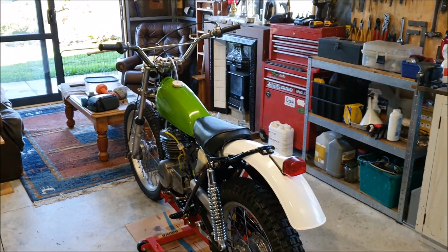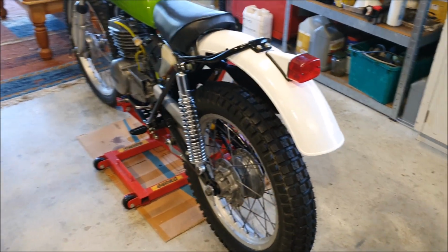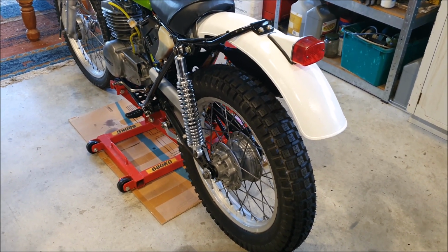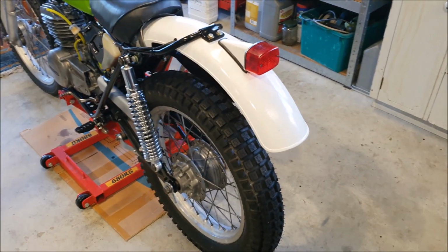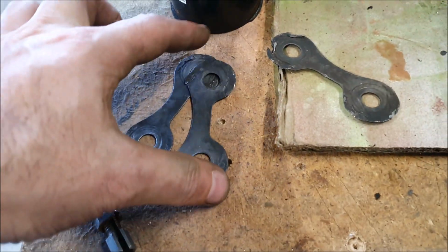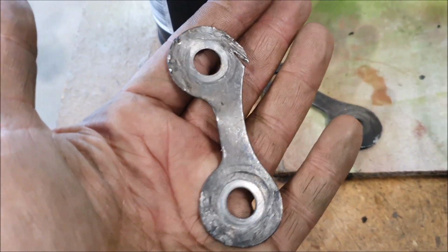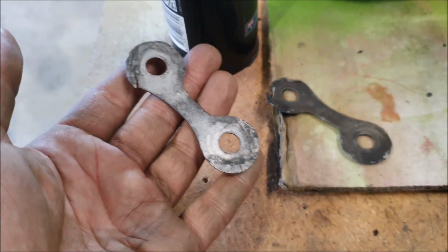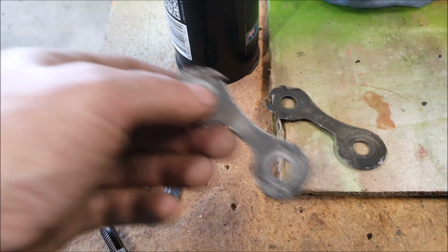I wanted to try and get quite a bit done on the little motorcycle. So you can see I've got the wheels mounted. They're just temporarily in place. The pin goes through the bearings, but I haven't actually done the brakes or the rear sprocket. So for the rear sprocket, I need to make some new block washers like these. These are just 0.8 steel. Ideally you'd get them sort of water jet cut or laser cut. I think I'll just make a set by hand. It's just going to be a hell of a lot cheaper.